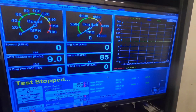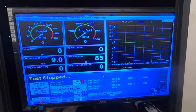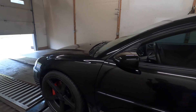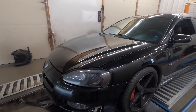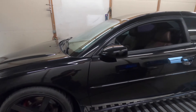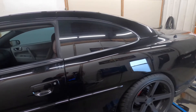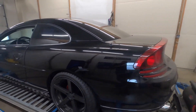Got a couple of issues, one of them being the intercooler pump — it's struggling to keep up. The intake temps were starting at about 76 degrees. Remember, it is air-to-water. By the end of the pull in third gear on 10 pounds, they were 110-112. So we definitely need to move more water through the core and deal with the wastegate spring issue before we bring it back.